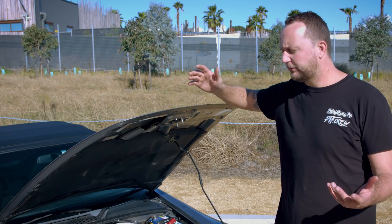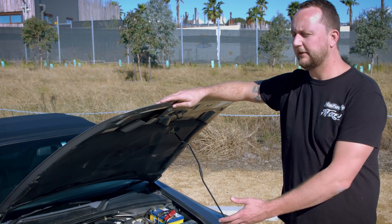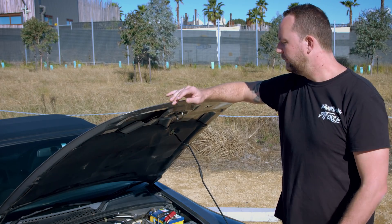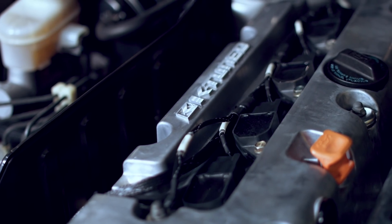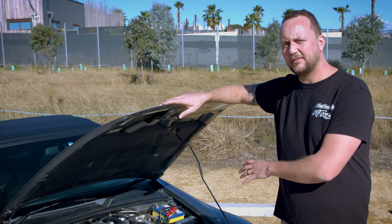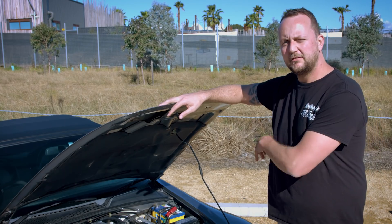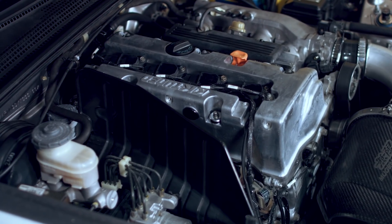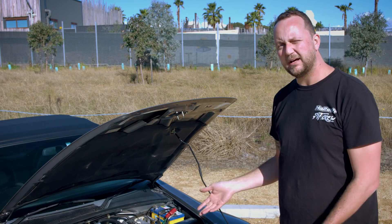One of the first things you've got to wonder about is we've swapped a four-cylinder for a four-cylinder. Because we started with such a good base in the F20C in the Honda AP1, we weren't going to get a huge advantage, but it's a driving advantage. This thing was the F20C — a two-litre engine. We've changed it to a K24 bottom end with a K20A cylinder head. We've lost revs but we've picked up torque. In a platform like the S2000 or the AP1, it's something a little bit peculiar. Where we've actually gained in this car is that the F20C has been sold for a huge amount of money. If this thing ever has any engine problems, it's not a drama — just another K24, slap it in, and we're good to go. We've got factory Honda inlet manifold, factory mounts, factory everything. We've got the Honda S2000 gearbox. Admittedly, you do have to use a bell housing adapter to get the rear-wheel-drive gearbox onto what was a front-wheel-drive engine, but that's no big deal.